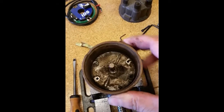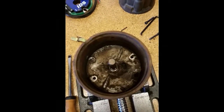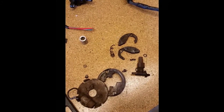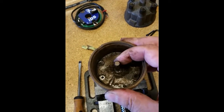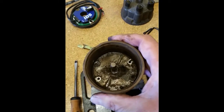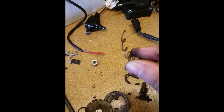I just checked out the John Deere distributor and that thing was junk, and this one is also. That's been almost a dozen distributors I've torn apart in a very short time period, and I've only found a few of them that function even remotely correctly. I'll keep tearing them apart and keep looking at them, but this broken spring being wrapped around the mechanism is actually very common.